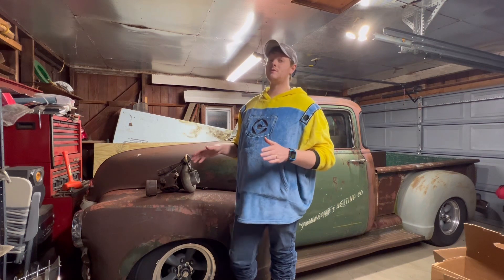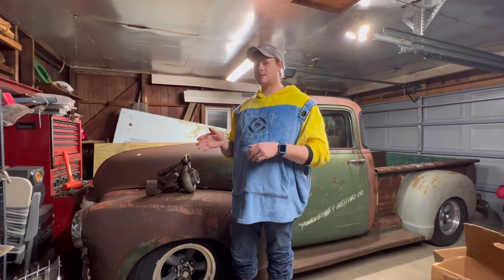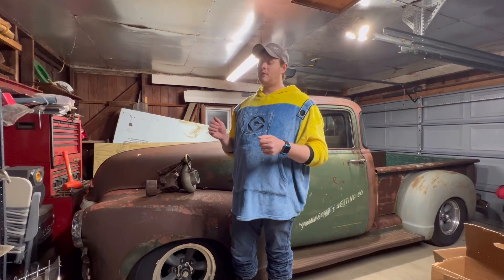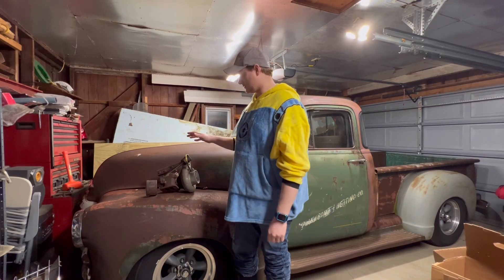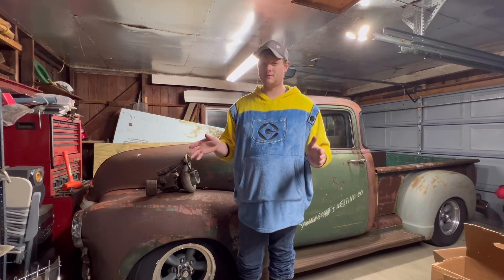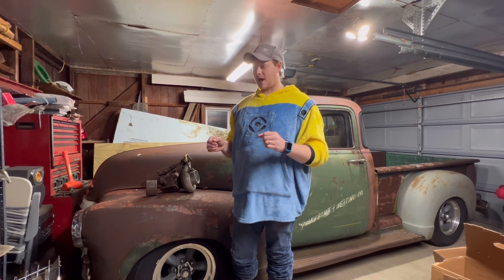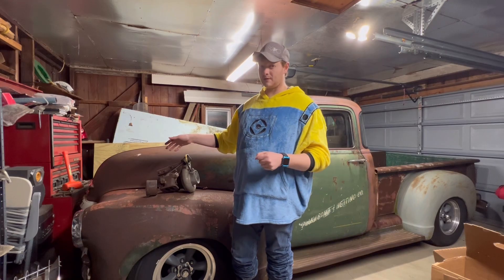You don't want the little ones that come on an HX40 W2. If you buy an HX40 W2, you need to make sure you get the right one. There are some out there that are 56/58 or 56/60. There are some that are 50/54. There are some that are 54/58 — the 54/58 runs like a WH1C, which I ran on Casper for years without a problem. When I put links out for a CKL HX35 or HX40 W2, I try to use links that have a 56 millimeter compressor wheel and 58 exhaust.